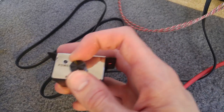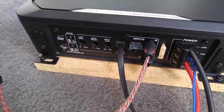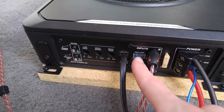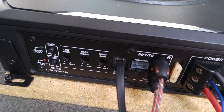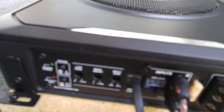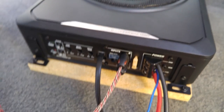If you get the right power connection, the light will show green for power. If you don't have an aftermarket stereo, use the included plug-in and connect the wires to each side of your speaker. After everything is connected, always do a test setup before final installation. You'll want to adjust the low pass, bass boost, and input gain to best fit the sound for your vehicle — every vehicle will be different.